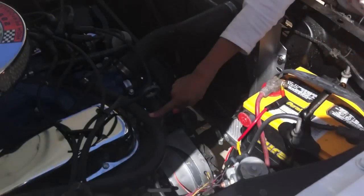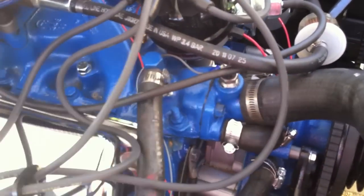Okay, the '66 is back. Here's another day of the '66 — her heater core is leaking. We didn't do any work on the heater core, we just simply hooked it back up to the engine and she's got antifreeze coming down from underneath. So what we're gonna do is unscrew this clamp and that clamp, cut these lines off up to the back of the heater core, which is basically a little radiator in the heater box down there.